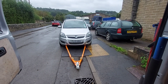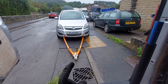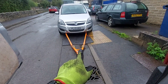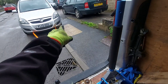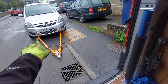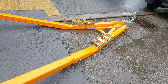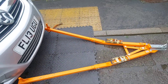I'm going to be towing it with an a-frame, which you can see there — these are brilliant. I've used this a few times; it allows you to tow by yourself. I'll show you how it's set up. It attaches to the tow hitch, you've got two ratchet straps with straps that hook into the chain, connecting the chain up to the ratchet strap. You can then pull that metal bar on each end against the front of the wishbone. These chains go over the wishbone and then get pulled tight by those ratchet straps.